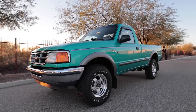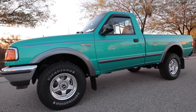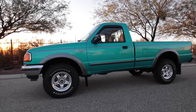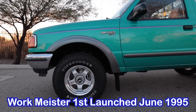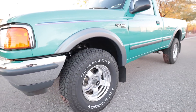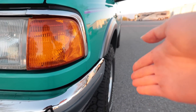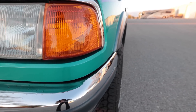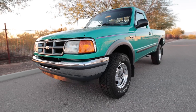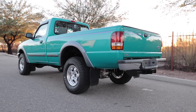I don't think anyone's ever done this before. I decided to go something super similar to the stock spec wheel because I wanted this to look like someone styled this truck in the era of when it was new in '94. I know this exact wheel might not have been available then but it's pretty period correct looking, especially in the silver with the polished lip. It's a positive 10 offset so it's super close to OE spec — pretty close to being flush but I wanted it to look stock spec. I didn't want crap flying all over the side of the truck. I may do a leveling kit in the front just to bring up the rake a tiny bit, and then I'll be able to clear a 31x10.5 tire, which I think would just fill it out perfect.